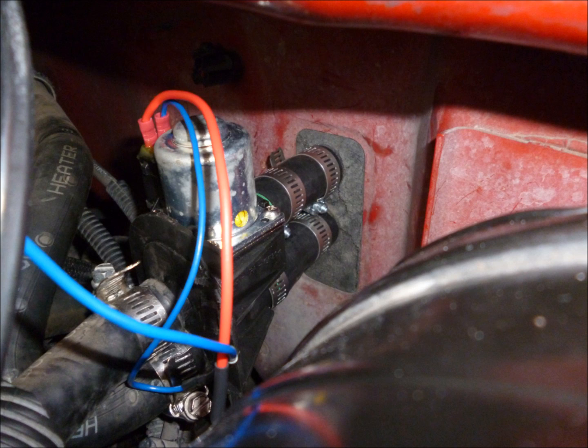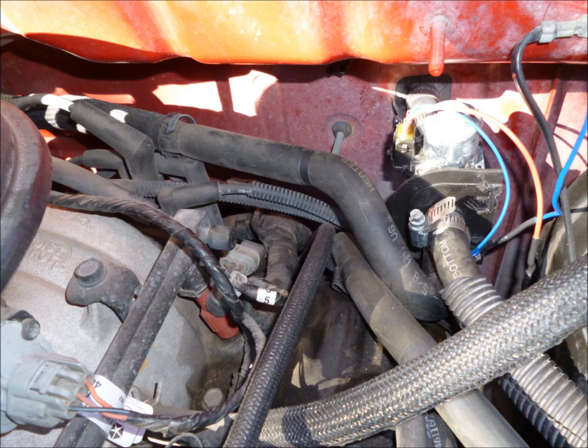So I struggle with a pair of pliers and finally get it done. You can too. And remove those two heater hoses. It's best on the one going over to the passenger side that you leave that little hook in place, and that will go on the bottom of the bottom tit on the core regulator, and the top one will have the straight hose and go to the water pump. It's fairly straightforward to put that in place.